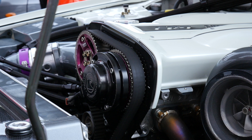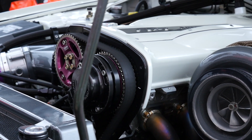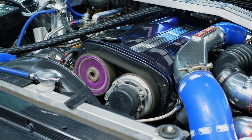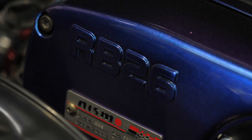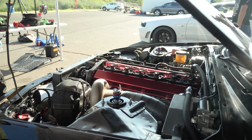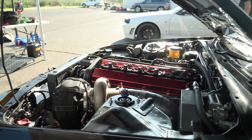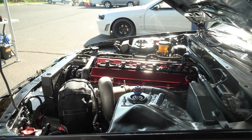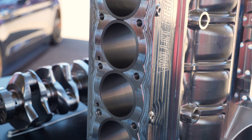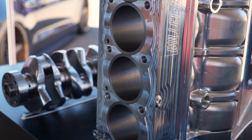Absolutely, and support under the exhaust ports — for example the RB cylinder head is 105 foot-pounds, that's all you can ever torque them to. But they're distorting, and when you have to machine out the combustion chamber to get the boost and timing in because you're running high compression, you have all sorts of limitations with that combustion chamber buckling, usually on the exhaust side because the support's been removed. If we can go up to huge tension because the support and the deck are there, we're matching the limitations of a billet or cast block, and the sky's the limit.